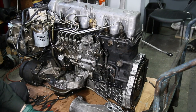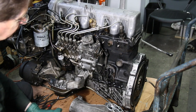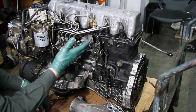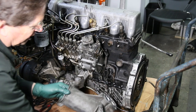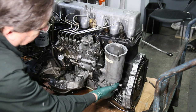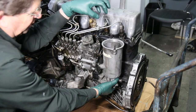In this warning I want to talk about one of the more common leaks in these OM616 and OM617 diesel engines. This is a 1982 five-cylinder turbodiesel engine. The leak occurs right in this area, at the bottom of what is called the oil filter housing. The oil filter housing bolts up on here like this and this holds the oil filter on these engines.